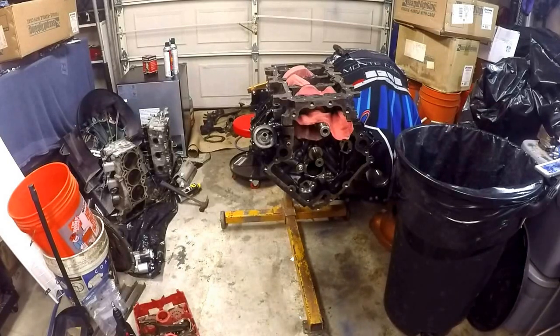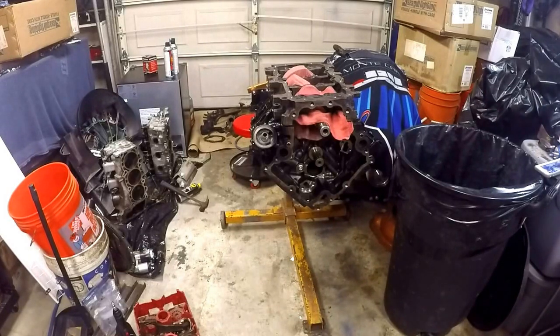I want to go over the plan for the motor. On the rework side: we've boiled, honed, and inspected the block. The main journals on the crank were polished and they look real good now. We're going to have the heads rebuilt with new press-in valve seats, new seals, hydraulic lifters, and at least one new valve. They'll check the rest of the valves to make sure.